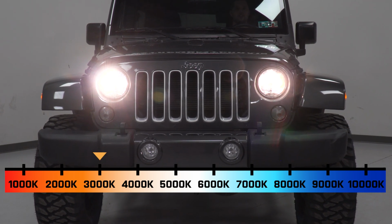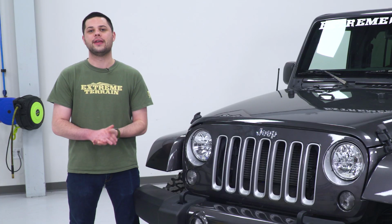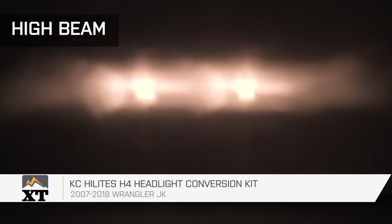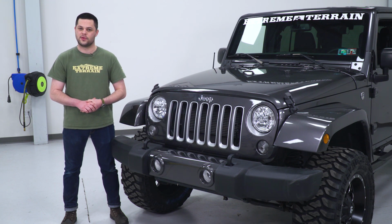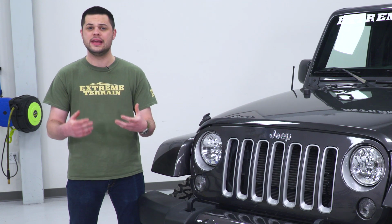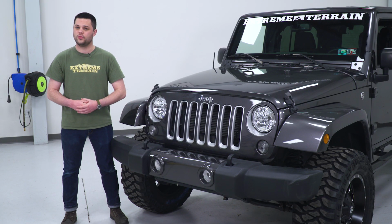A reflector housing like this headlight uses is more basic than other options. The philosophy here is to scatter light in all directions, which leads to a functional, albeit messy beam pattern. The hotspot is decently bright. We'll use these as the standard in terms of brightness. They're more inefficient than other options as well, since they create a lot of heat. That can actually work in your favor by keeping themselves defrosted during the winter months.